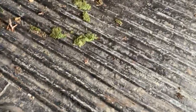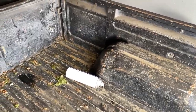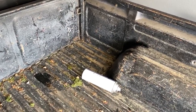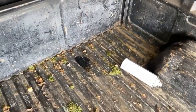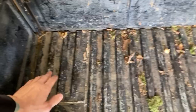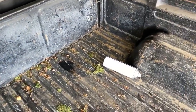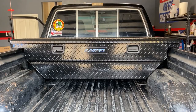I got the bed cleared out so we can mount that toolbox. Just because it's a rock crawler doesn't mean it has to be a piece of junk. There's a lot of metal under that toolbox that might not stay dry, so I'm going to paint the area under the toolbox to ensure we don't form any rust holes over the years. I got the area pretty clean, so I'm going to drill out the holes, move the toolbox, paint it, and then mount it up.